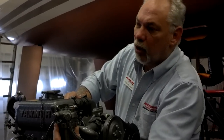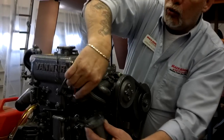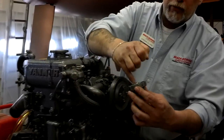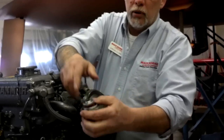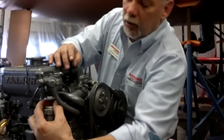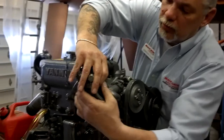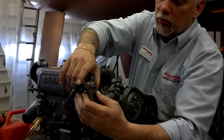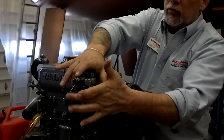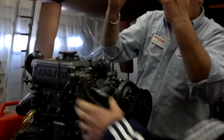Now, in some applications you may not be able to do this — you may not be able to put this filter in. And then slide this canister up. Because of room? Location. Because this hose may be in the way. There may be a hot water hose running through here, so what you may have to do is do a combination: put this in there, set it up inside, pop it in place, and then install it. Finger tight — all you're going to do is just take it finger tight.